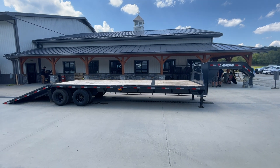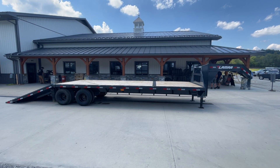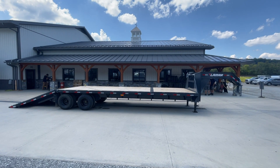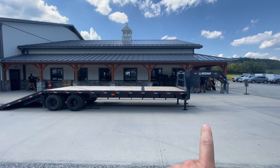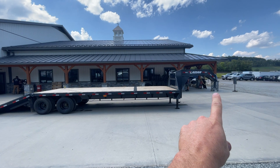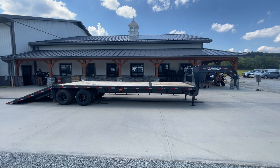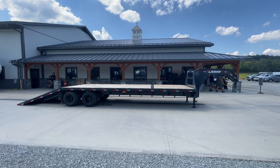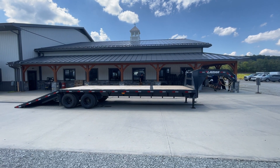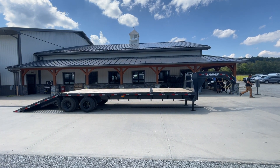Per the manufacturer tag, this trailer is going to weigh in at about 7,200 pounds — sounds just a touch light, but in the ballpark. At a 24,000 pound GVW minus 7,200 is going to give you about 16,800 pounds. It also does not count your tongue weight. Tongue weight is generally 22% in a gooseneck — a more accurate number, if you want a very precise figure, is about 1% per foot from the coupler to the front axle. Using 22%, you're about 5,000 pounds on the pin, which is going to give you about 16,200 on the trailer side and about 5,000 on the truck side. Total legal payload would be about 21,000 fully, perfectly balanced, maxed out.